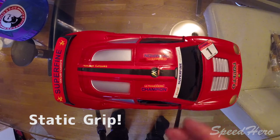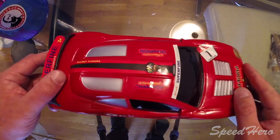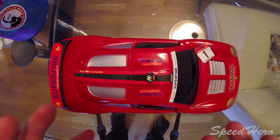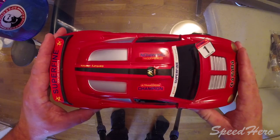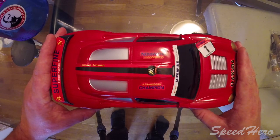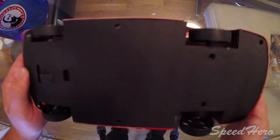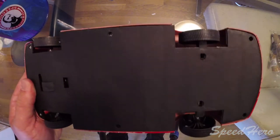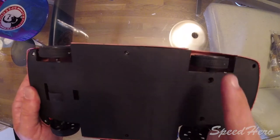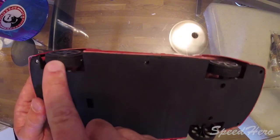So we want to put the weight on the tire, and that contact patch is our control of drifting — because where we place the weight, it will naturally place the grip. Static grip is the grip that we're going to base the dynamic grip on. Dynamic means that the weight of the car is moving around, changing the pressure on each tire. The tire with the most weight is going to have the most grip. Static grip is our basis in which we base dynamic on, and it's settled by two factors. The first is the natural grip of the tires — this car has the same grip both front and rear, because it has the same tires, the same compound, and the same amount of air inside.